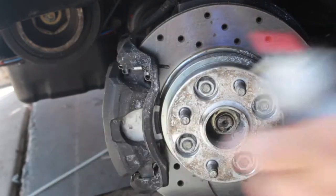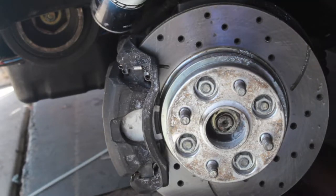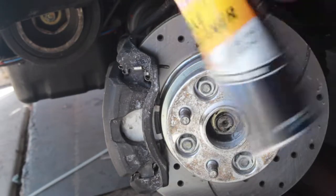There are different methods to doing this — some people remove the caliper entirely, scrape it with a metal brush, and clean it with isopropyl alcohol. I went with this method because I'm probably going to be replacing the calipers real soon. I just wanted to have a little fun and practice my painting skills. I'm going to use some brake cleaner to clean off as much as I can. I already got some electrical tape and covered both boots because they don't do well with brake cleaner.